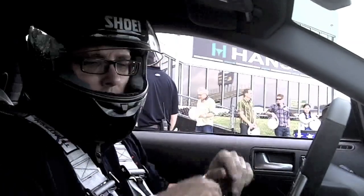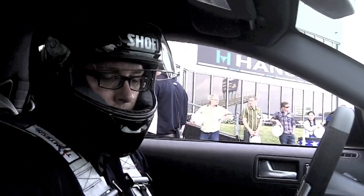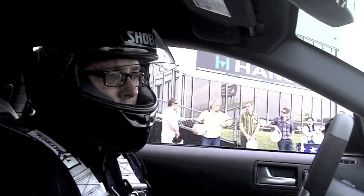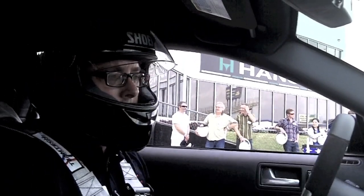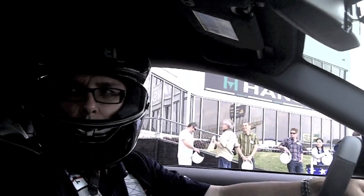If I went into the water box in this mode, we'd go nowhere. We'd actually go somewhere. We wouldn't spin the tires though. In order to get into a mode where I can spin the tires up, I'm going to turn off traction control. This is going to flash up a warning screen that says launch control unavailable. It says OK in the bottom right corner. To clear that, you hit OK. All right. It now says RPM only mode.